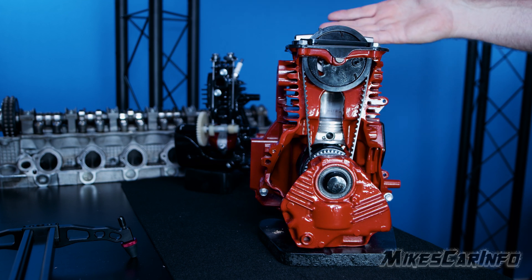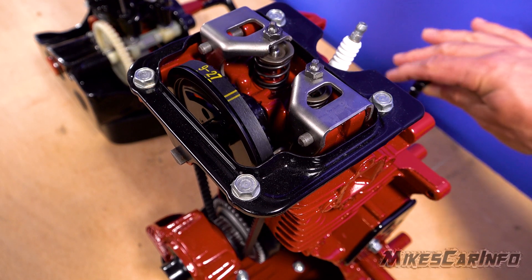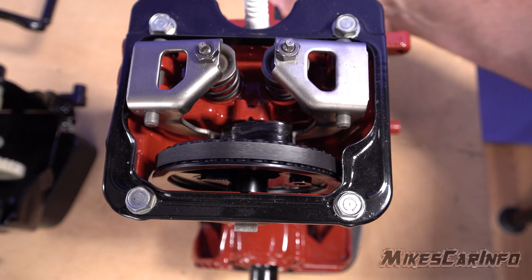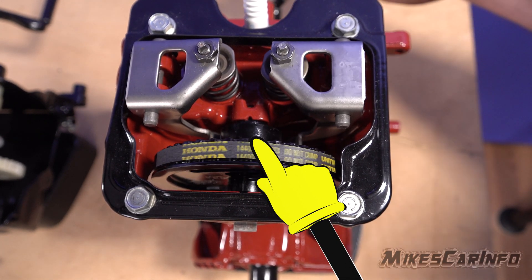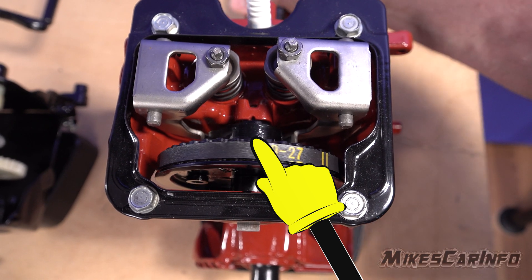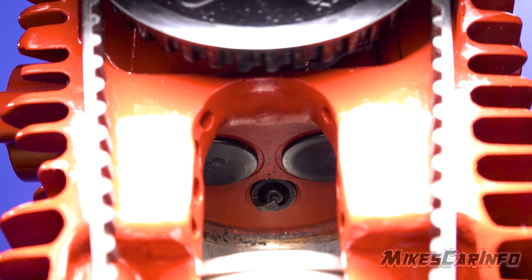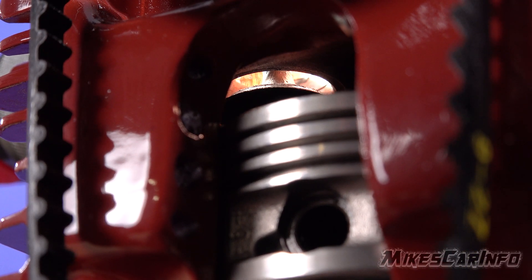You've heard of an engine flooding. Well, that means it's getting too much gas. So there are two valves on top — the intake and exhaust valve. On this particular one it has an overhead cam with one lobe, which is very rare. Usually there's a separate lobe — like a little bump that opens and closes the exhaust and intake valves. Normally you'd have two lobes on the cam shaft to open the intake and exhaust valves. Think of a hose with a nozzle that you squeeze and you get water flow. These valves are the same thing, except instead of water coming out of the hose, you're allowing air to go in and out of the cylinder.